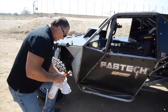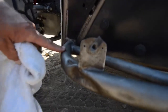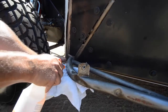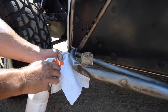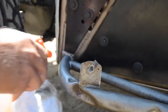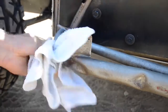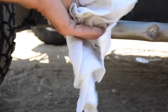This is how easy it is — I'm just going to spray it on right in the front. Get up close here. You can already see the little rust already in the frame; this has been Scotch-Brited and WD-40'd and the rust is already coming back. So we're going to clean this section, spray it on using these little spray bottles, let it sit, and just wipe it. You'll see the rust come right off the frame — it's pretty much that easy. We'll let it sit for two or three minutes then wipe it off and you'll see the metal getting cleaned.